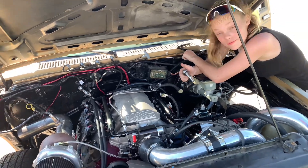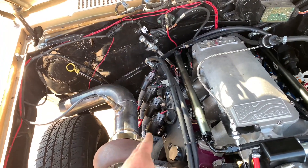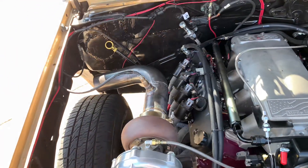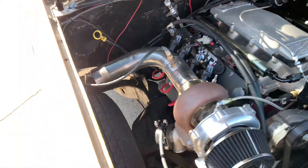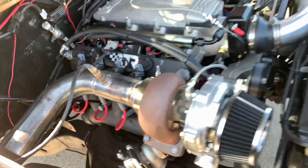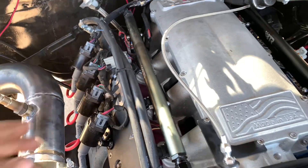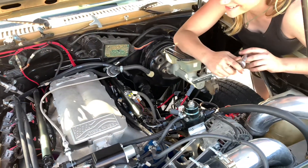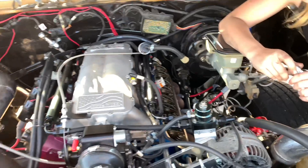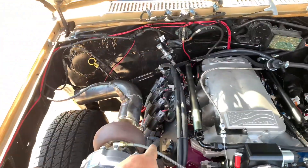It is the morning of race week. We've switched over to the other set of coils because they're further away from the exhaust. We've got new wires and plugs — thanks to Nico for running and getting that for us. We also switched out the harness on this side because we had one that was a lot better, and we fired it up — still had a misfire.